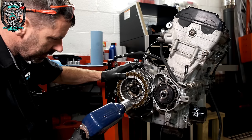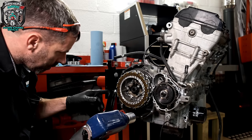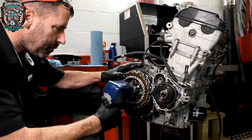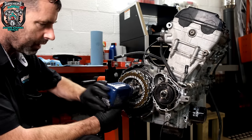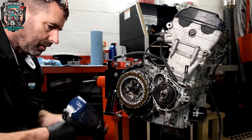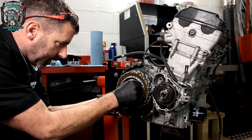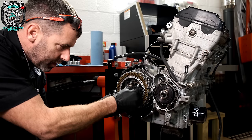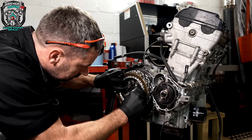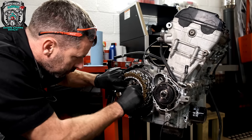So why are you taking the clutch off? Well, I can't exactly remember, but there's going to be stuff behind here that's in the way — basically stuff that needs to be out of there before the crankcase can split. I know a lot of you cringe when you see impact guns being used, but you've just got to know when to use them. It's so much easier than trying to use a clutch holding tool.